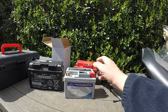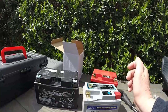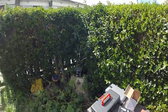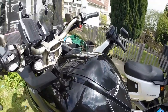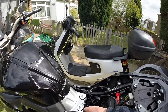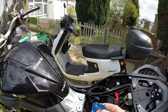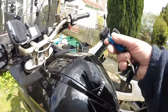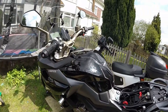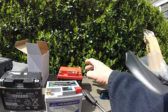It's enough cranking amps to start the bike up. The issue is when the bike has stopped it's draining power. I know why mine's draining power — it has a remote key system, a PKE system. There must be some power drainage within the PKE and the computer brain to keep that active so when you press that button the bike just starts straight away with no key involved. In four weeks it can drain about two of the three amp hours the battery holds, so it won't have enough cranking amps to start.